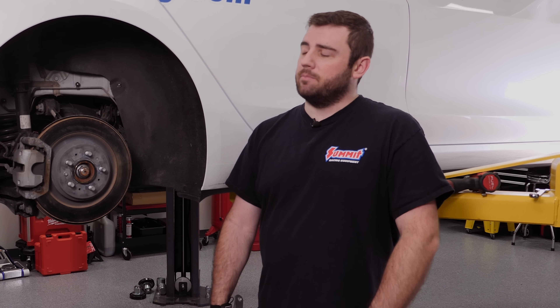We're going to target somewhere near the negative two degree camber range and just see how that goes. The nice thing about it is they're all adjustable, so if we need a little bit more, we're going to be able to figure it out at the track. We're going to have tire temperatures across basically from the inside to the out — very scientific. And with that, let's hit it.